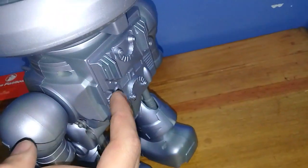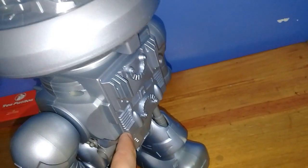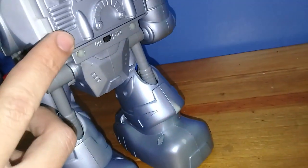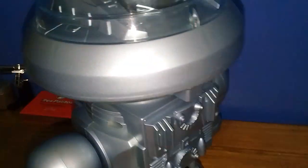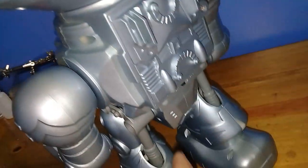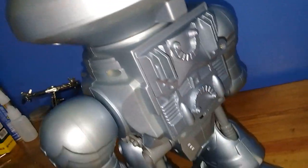The four AA batteries are in here. The last battery had the negative terminal, which connected to the switch. It was corroded, and it was actually rusted, believe it or not. It was rusted, and the corrosion went from this to the wire, from the wire to the switch, and as the switch was always turned on, if it would have been turned off, the thing would have been a lot less of a damage. Because there would be nothing related to the corrosion being touched. So if this was turned off, it would have been a whole lot better.